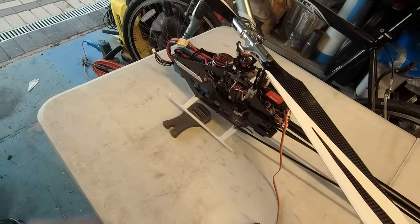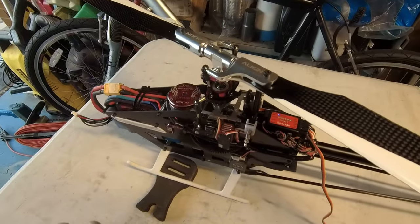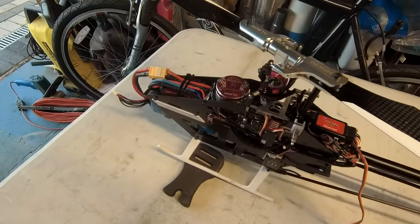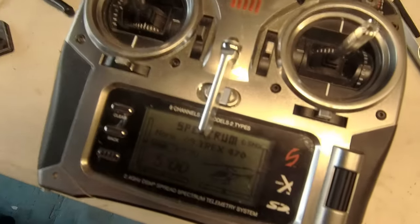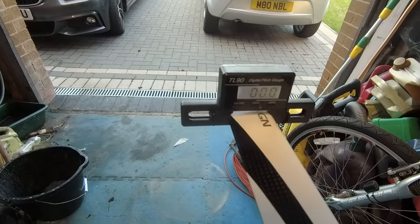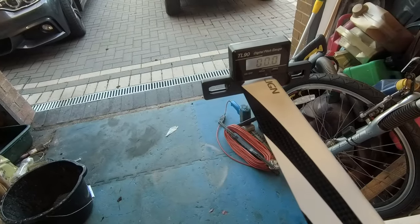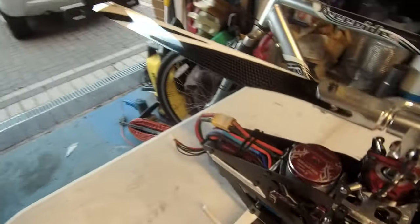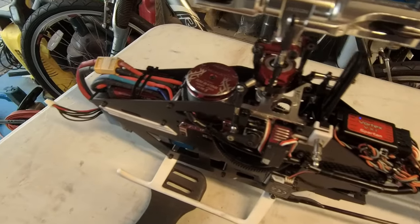Because I've had everything off in this area, I'm not going to go through the setup on the datapod yet. I'm going to get the stick at mid-stick and just check that everything mechanically is right. As you can see straight away, that blade is at six degrees, and the other blade is at zero - so they both need a little bit of adjustment. Mid-stick again, yes the monitor confirms it is mid-stick, and there we go - that blade is now at zero. Both blades set up.